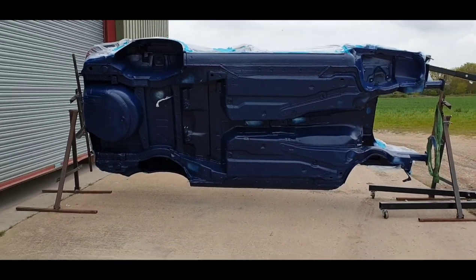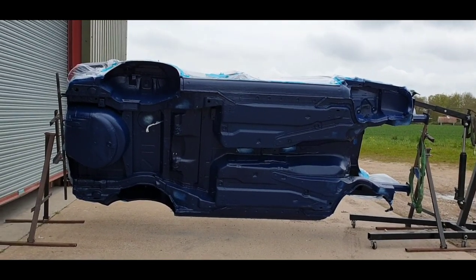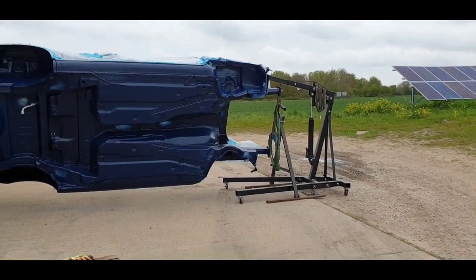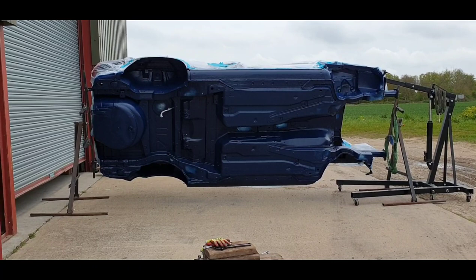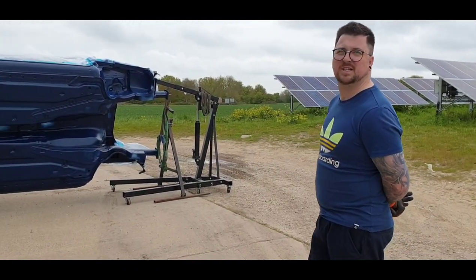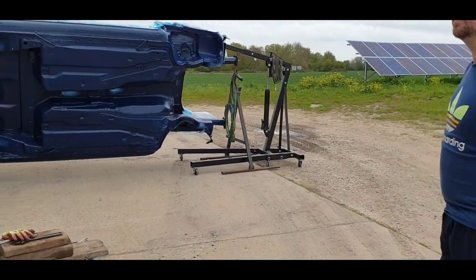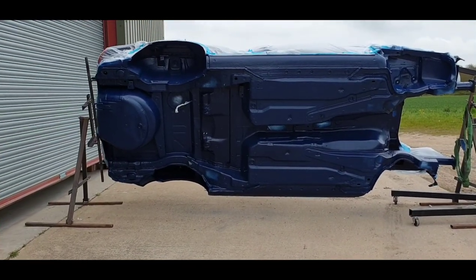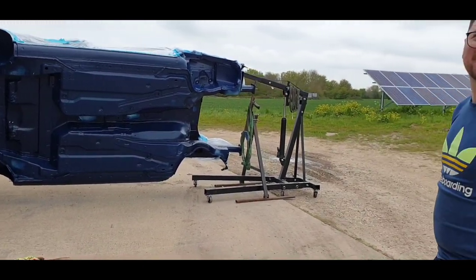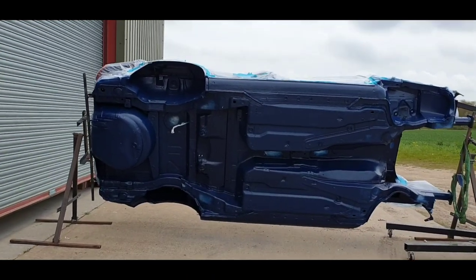But anyway, so that's arch tubs done, Raptor the whole floor. That gives us such a good base for this car. With everything that we've got, all new bushes, all new brakes, we'll put new brake lines on it. What are the brake lines that you get? I can't remember what I've got. That stuff that is copper but isn't. Copper alloy. Yeah, it's the one that doesn't rust, so it won't go green or horrible. It's the good stuff. So with that all underneath it, everything's been powder coated and restored.